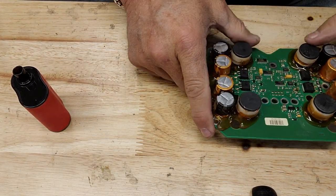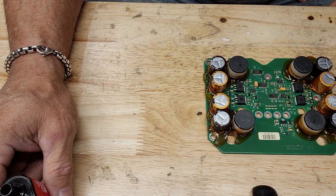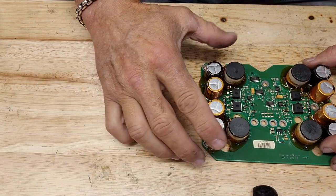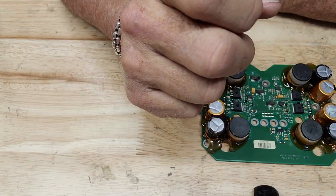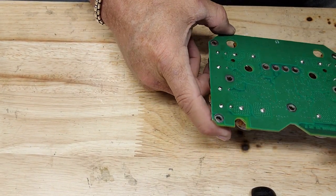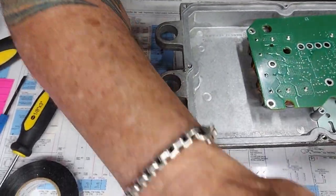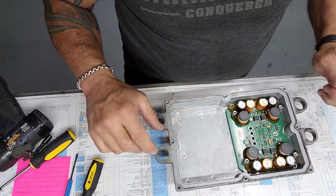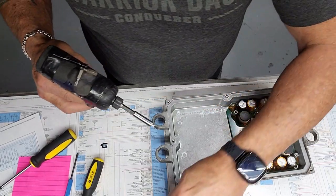These things are notorious in the 6.0s. If you're having hard starts, no starts, or just generally taking a long time to warm up and get running right, this is most likely your issue. The theory behind 58 volts versus 47 volts is that it opens the injectors up wider and faster — whether that's true, I don't know. I personally don't understand why, when something fails at such a high rate as these things fail, you would ask it for more than it's doing. It fails at 47 volts all the time, so I'm not sure running it at even higher voltage is a great idea.